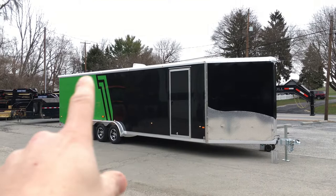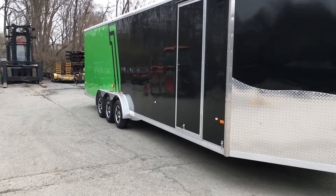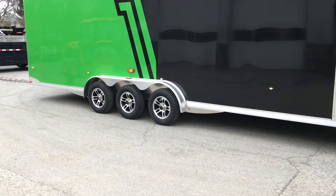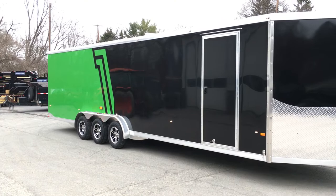While we've got a nice pan shot of the whole trailer, you'll see there are a few extra markers up top and a few in the middle level. On a seven and a half wide, you get a bit of fender on the outside but also a fenderette on the inside. The seven wide is the biggest you can get without any fender on the inside. They do a couple neat details — scoops in front and behind the fender. This one has aluminum wheels, and on a seven and a half you're also going to get torsion suspension. Notice this one has the two-tone — I believe that's called the Bradley two-tone.